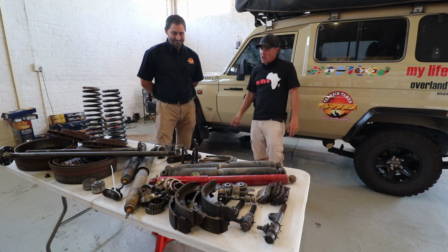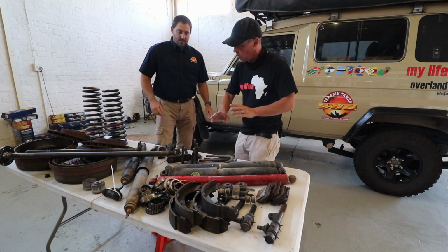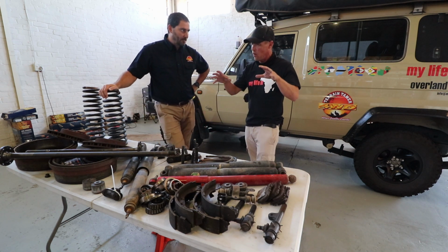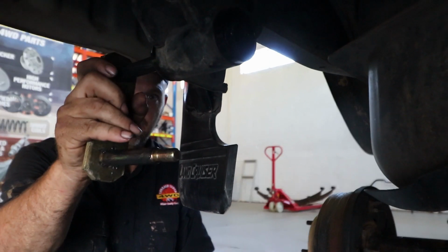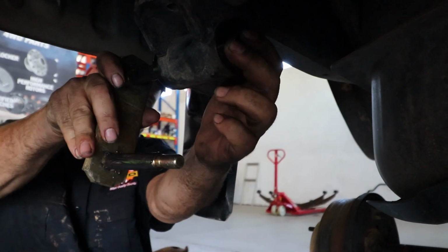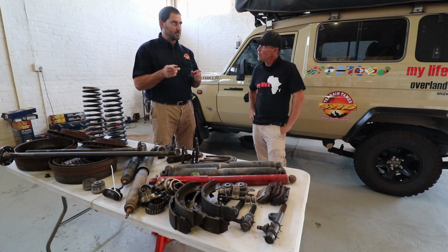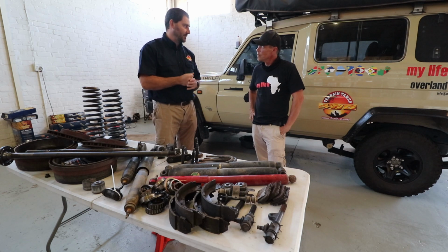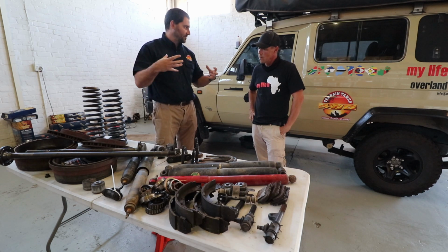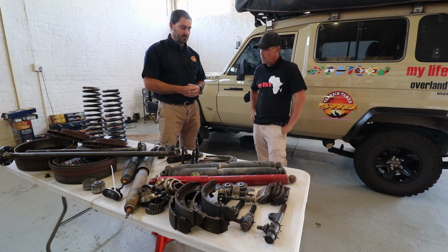Nice and lean. So now the parabolic leaf springs themselves, you change all the bracketry. So it's U-bolts, all the brackets. What's the reason behind changing all the bracketry? Yeah. So on your shackles and your pins and so on, you will see your old pins are actually not greasable. So we changed them to greasable pins and shackles, just because it's lubricating, but also now it's cleanable. So every time after a trip, you'll put in new grease, it pushes out all the water and dust that went in there, and it actually cleans the whole system, so it's much better.